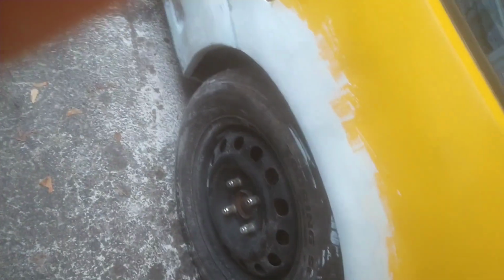That's pretty much gonna wrap it. As far as body wise, everything is covered. Daylight is going really fast on me. It's not like I could just dry this in 15 minutes and sand it. However, when I let it dry, come back tomorrow and sand it, like I said, it should look good, both sides, everything we touched up, to the point that I could just hand sand it, no machine, burring off in some spots, and that should be able to get primed all around.